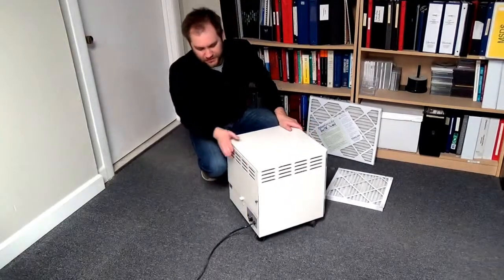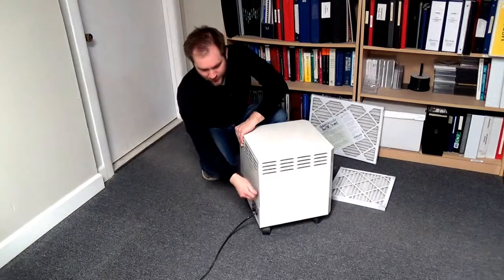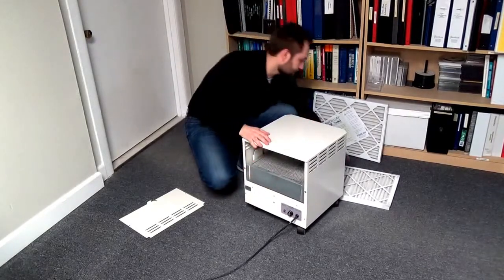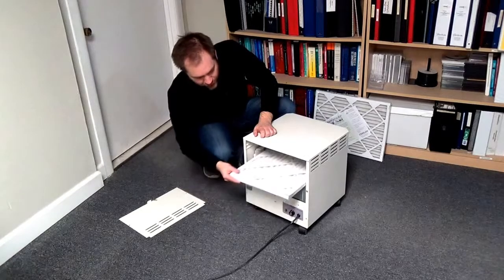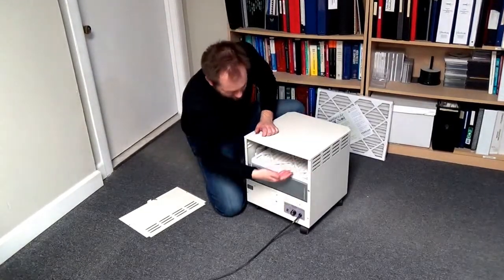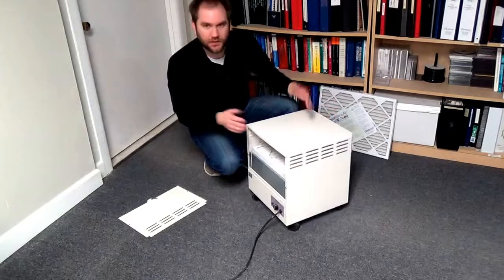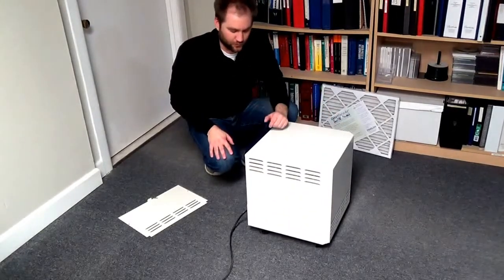This unit is nice, small, and portable. To install the Odor Cleanse Air Cartridge, just remove the back panel. Inside you'll see it's already got a HEPA filter installed. You just slide the Odor Cleanse Air Cartridge right on top of the HEPA filter, and you want to ensure that as the air circulates through it, it passes through the Odor Cleanse Air Cartridge and then through the HEPA filter — removing chemicals, odors, and pollutants from the environment.